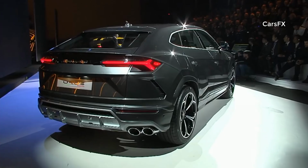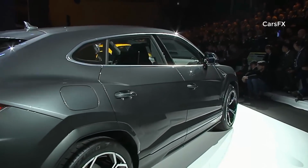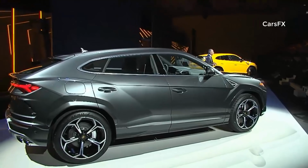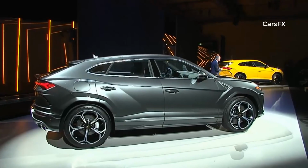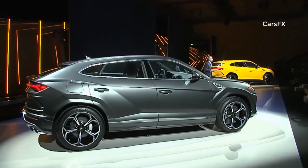As you can see, the wheelbase is quite long for this car, so in order to make it more agile, we've introduced the rear wheel steering. This makes it possible for the car to improve its dexterity, and it is as if the wheelbase can radically be shortened by 50 centimeters or so. So you can shorten a wheelbase or lengthen the wheelbase depending on the driving conditions in order to guarantee the best stability conditions under any circumstances.